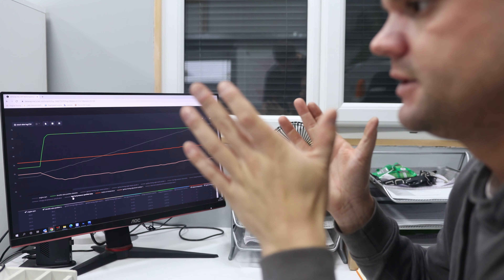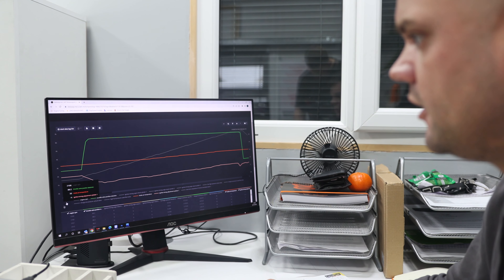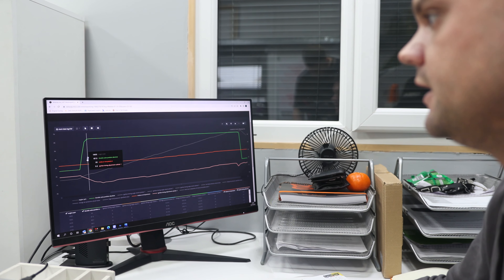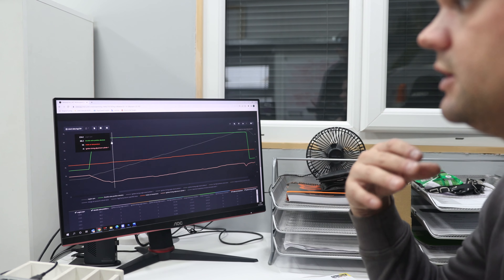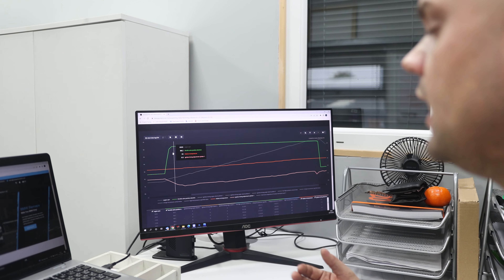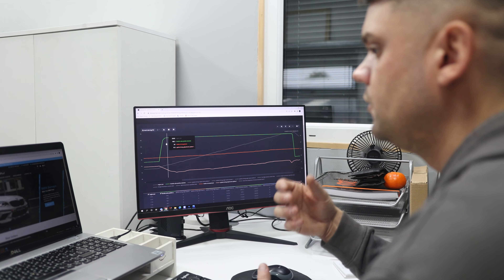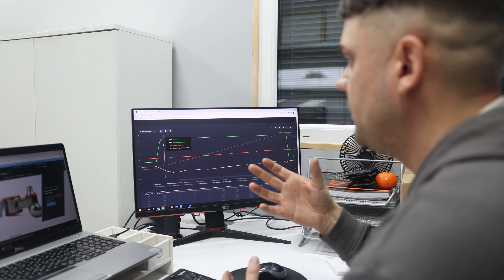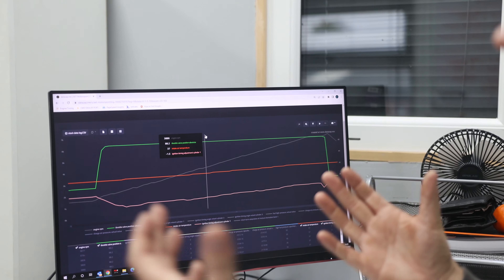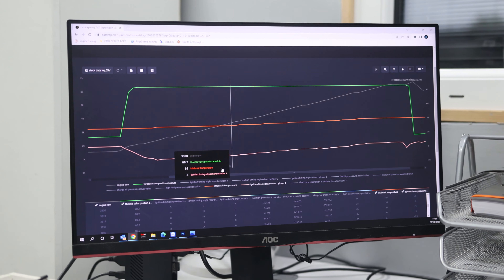To give some indication without going too deep: you can see here the engine RPM rising from where the dyno holds at 1,500 RPM, and this car finishes at 6,500. The green line is telling me that although it reads 88% throttle position, that actually means 100% in real terms — so the throttles are open completely all the way through the run. On modern electronic control systems, if there's an issue with too much boost or unhappy fuel pressure, it will dip where the throttle closes to avoid damage — that's called component protection. We've got full wide open throttle all the way up to 6,500 RPM.